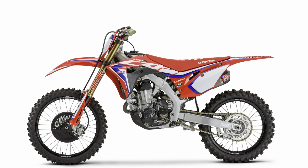The front brake calipers, also an update from last year, have a 30mm and 27mm piston instead of 2 the same size. That's the same way HRC actually does their brake caliper. The leading edge piston is smaller, with the piston that's farther into the travel of the rotor bigger. It basically applies what they feel is an even pressure with the brake pad. If you have 2 the same piston sizes, it tends to push the first area of the pad in enough that it catches the rotor and starts to wear at an angle. If you've ever taken your pads out and they're angled, supposedly switching to this piston design helps even out that pressure.